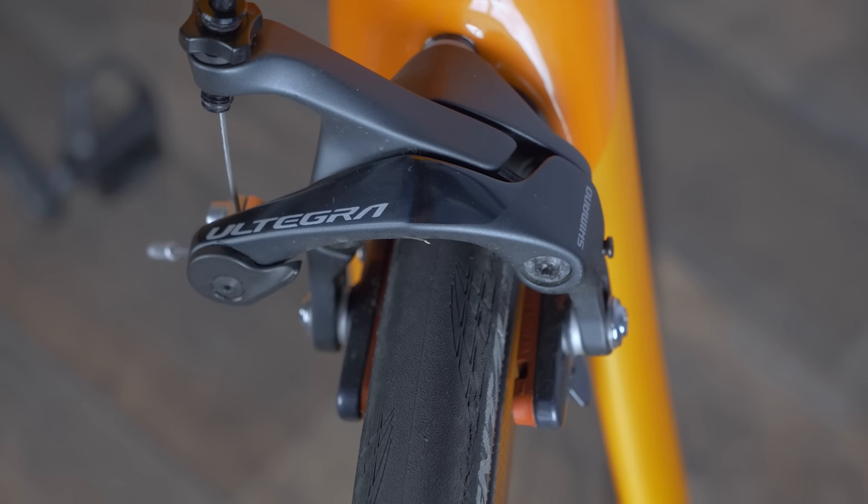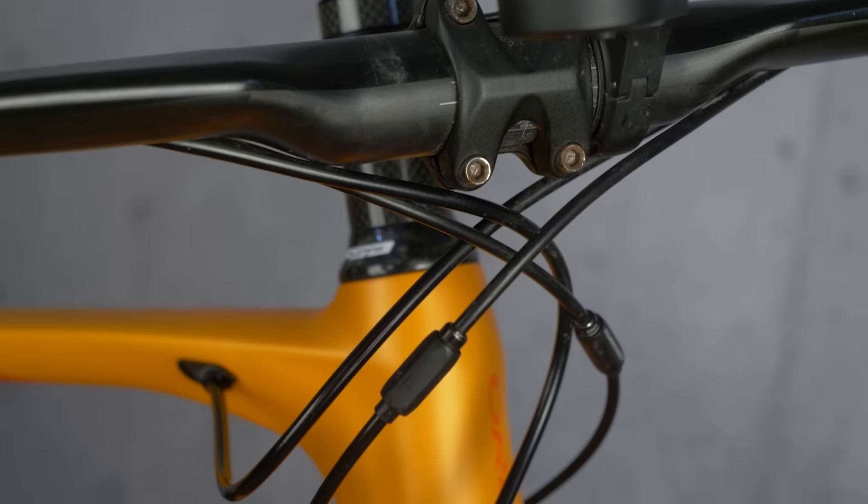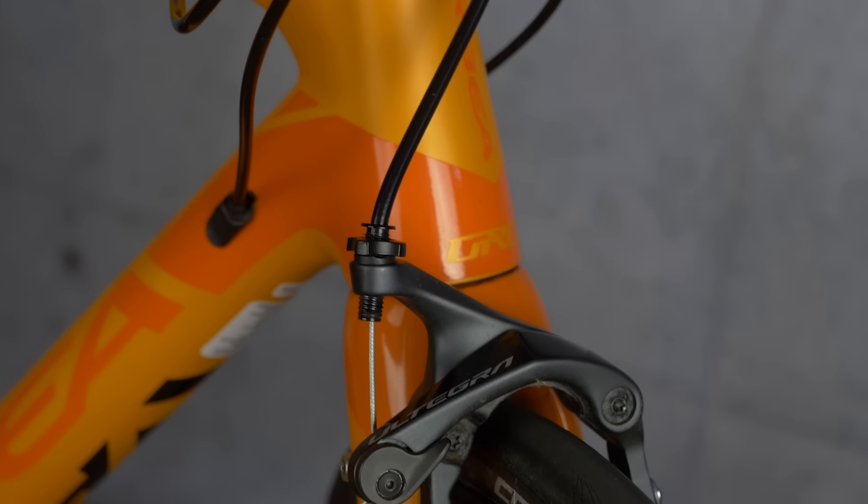Cable run makes a big difference to the performance of any cable-operated brakes, which includes some disc brakes as well as the vast majority of rim brakes. Steel cables don't like sharp corners, which is a problem if you want fully internal cable routing with nothing showing between the lever and the caliper. The more convoluted the routing, the spongier the brakes feel at the lever. Hydraulic brakes — which includes some rim brakes, but not many — don't care much about tight turns. Everyone does seem to want the clean look and slight aero benefit of internal cable routing these days.